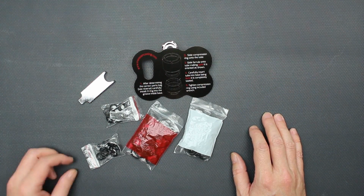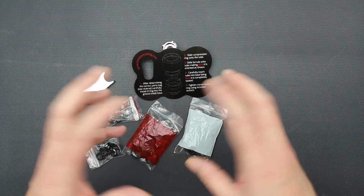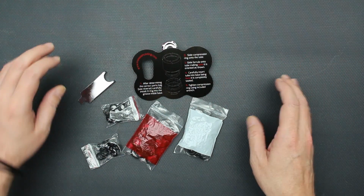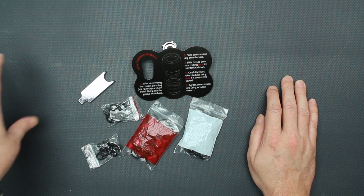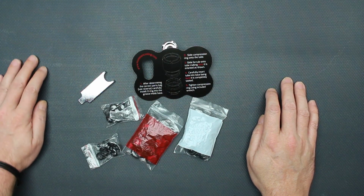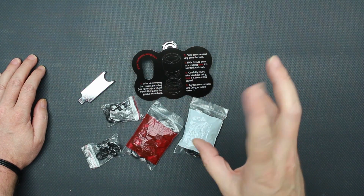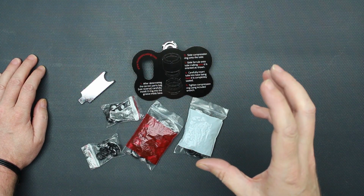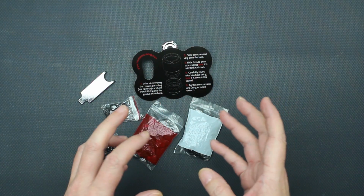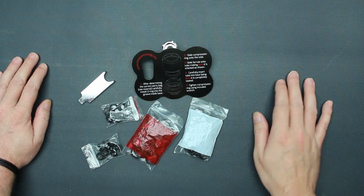That was never a problem with soft tube, because you just make the barbs a tiny bit bigger, and then the tube would stretch to go around them, no matter whether it was a little bit bigger or a little bit smaller, it was fine. We just can't really get away with that with rigid tube. And if you're using a push-in type fitting, in order to make that work, they have to make the seals in them slightly oversized to compensate, and that's why sometimes you get a fairly nice fit, sometimes it's not quite as tight.